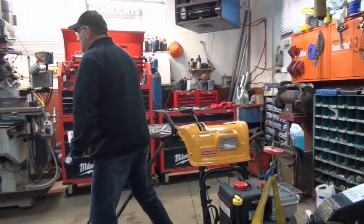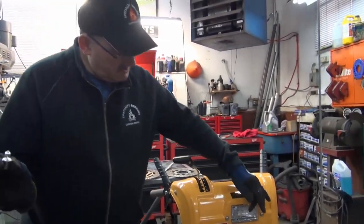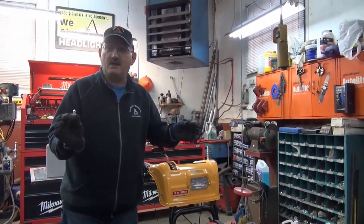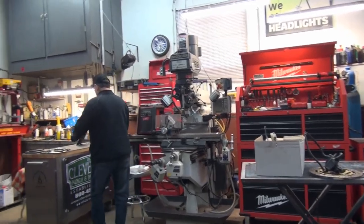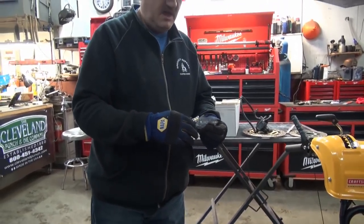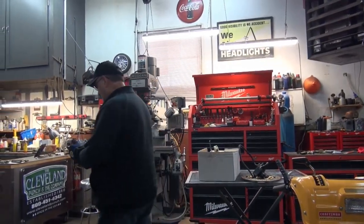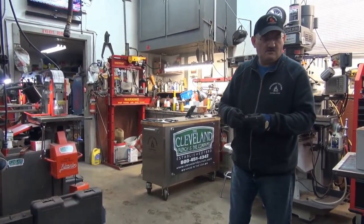One thing that I do recommend with these things is this is the halogen light that comes with those things. The bulb goes in here, mm-hmm. And they never last. Because these things, see, when these are running, they're all of a shake. Like they're basically ready to have a nervous breakdown. Everything's all of a shake, and that filament, when it heats up, can't take it. So my fix for that is LED. Perfect. And that will take the punishment. May not be quite as bright, but it's not bad, I'll say. It's a bright, bright white. So, yeah, it can handle the vibration. Yeah, I mean, that's the thing, right? I remember when we had a snowblower like that back years ago, before LEDs came in.